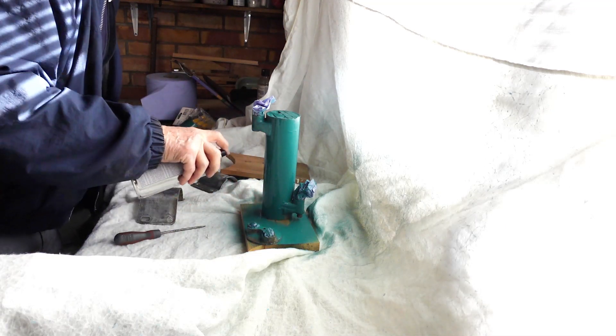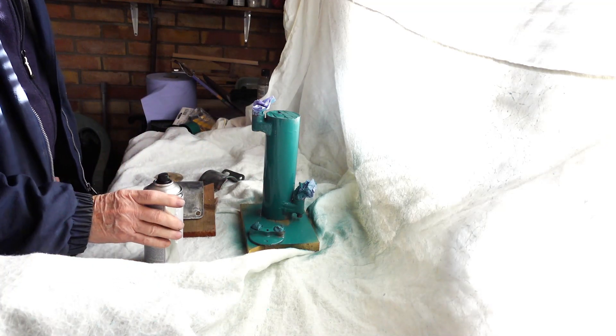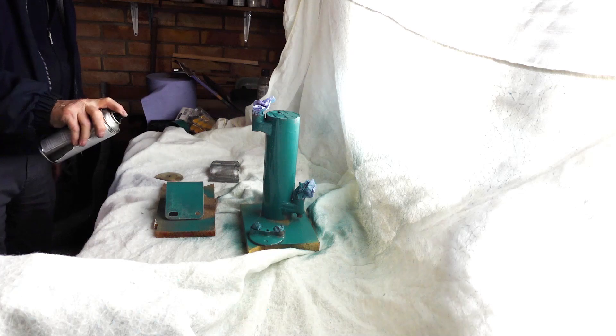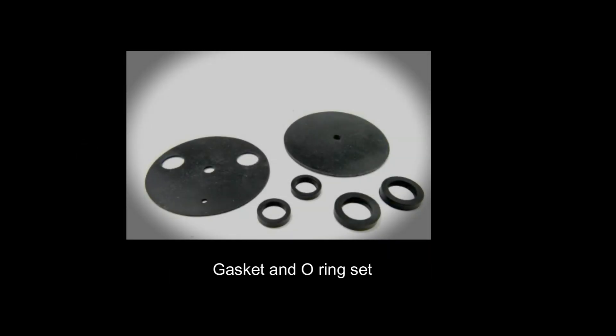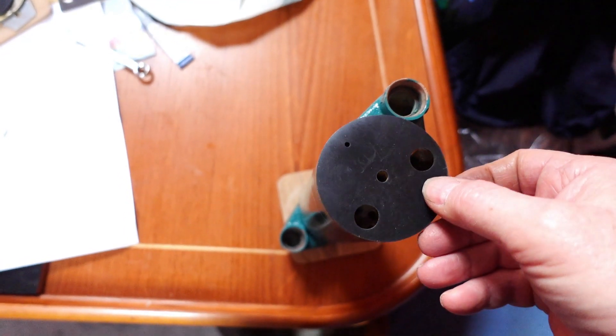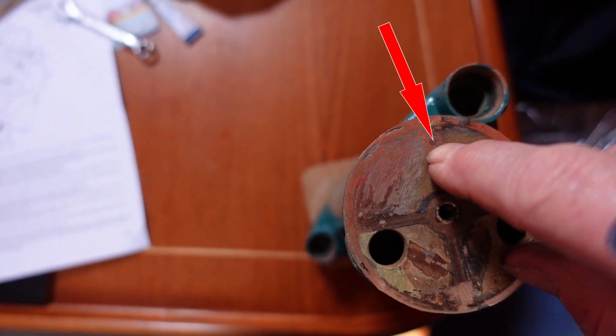This is time for reassembly. This is the replacement gasket and O-ring set. It's essential that you replace these when you reassemble the unit. It's quite tricky making sure the gasket fits exactly to the compartments and inlet ports on the end plate. There used to be a locating pin, but it's gone, so a dab of superglue will hold the gasket in place until reassembly.